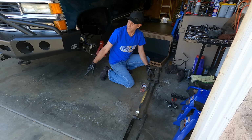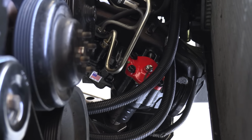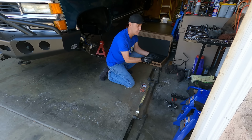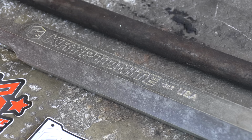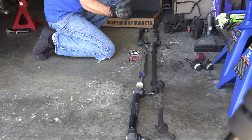Now, the only thing that you're not seeing here is the Death Grip pitman arm that I also ordered for this thing. It's already installed because I ordered an upgraded steering box. I got a Redhead new steering box because the whole thing that inspired this upgrade was the fact that on that long road trip up to Tahoe, the steering was so sloppy that it was just exhausting to drive for 8 hours on the highway. And so this is going to solve all of that. Now, this is definitely overkill for this application. This is designed for big power diesel truck type suspension, hard four-wheel drive launches.